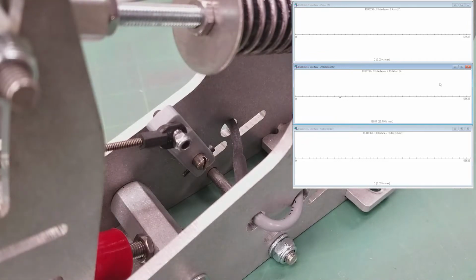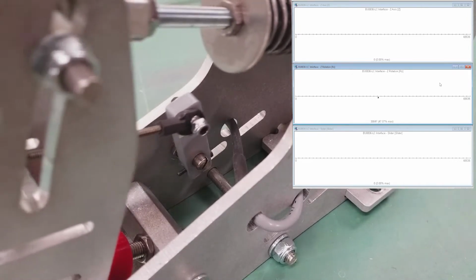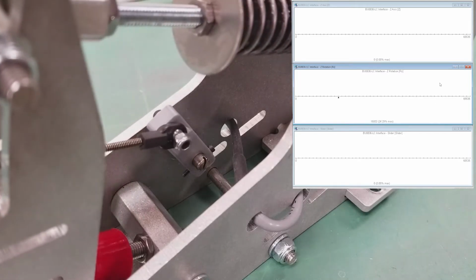Okay, so in the top right hand corner of the screen you'll see that I've got DI-View open and I've got the window open for the throttle pedal, and I'll make sure you guys can see that. Now I press on the throttle, you can see the slider moving around just like that. But you can see that the slider is kind of in the center there, hanging around maybe a quarter of the way up. And you want it to be back down to 0.